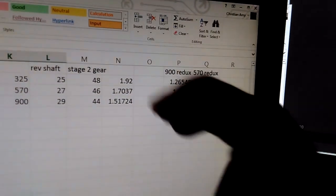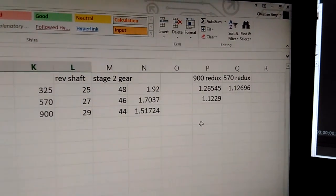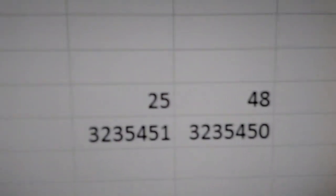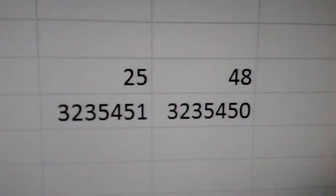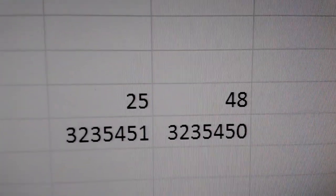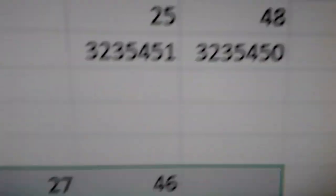You can get their 25% gear reduction — which is really a 27% — for less than $200 shipped from Polaris. The part numbers for the big reduction are shown here, the 4825 series. That's what you'd put in if you wanted to do the big gear reduction in the 900, or the 13% reduction in the 570.